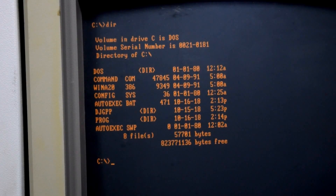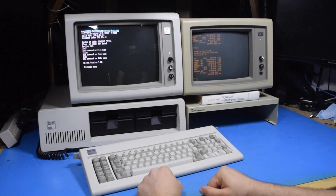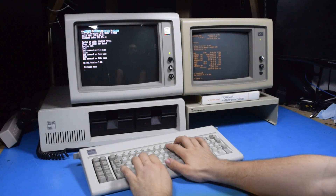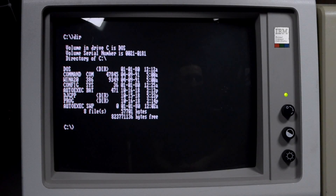The color monitor has bad caps tinting the image, and now the MDA monitor has some kind of wobble I'll have to figure out how to fix. Can I go to a store and just buy new old stuff? And this is definitively a multi-monitor setup on a 5150. Currently I'm on the monochrome monitor - I can run a dir command and it shows up on that one, and I can at will change back over to the color monitor and do something over there instead. Now let's take a closer look at that command I'm running to do that.